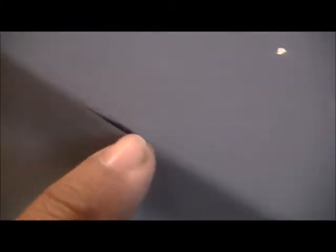So you can already see the reflection of that bed in the primer. That's what you want. There's a little guide coat here, still gonna hit. And along this edge, I'm gonna do it very gently by hand because I don't wanna burn through one, the paint, or two, the primer, which it's starting to do right here.